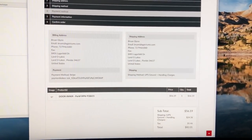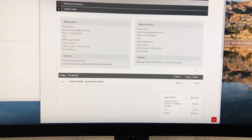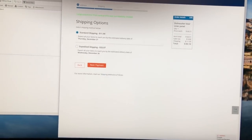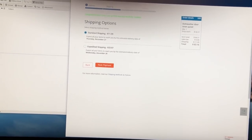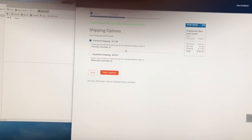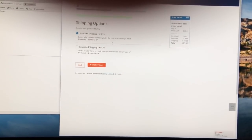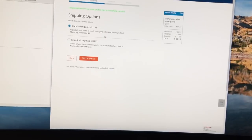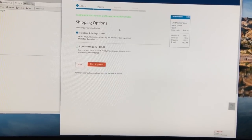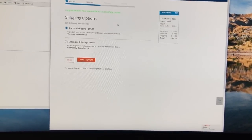Not bad - shipping is a little expensive because it's a big part, but the part itself is about $50 all over the place. Parts IPS has the best price at $82.01 but it'll take a week to get here. Sears is only a dollar more and it'll be here Thursday. I'm going to go with Sears - and while they're still in business. It's a very common door panel used on a ton of different units. So if you've got a leak there and your seal looks good, definitely take a look at the corner of your door - flex it all the way open and see if it's splitting and cracking. Found a YouTube video from an appliance place and it looks like it's going to take about 10 minutes to swap out.